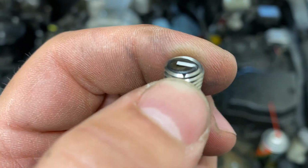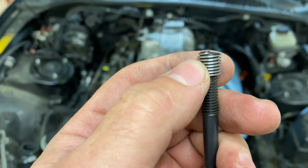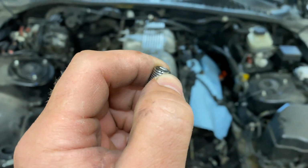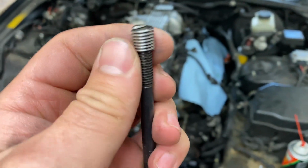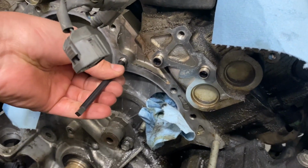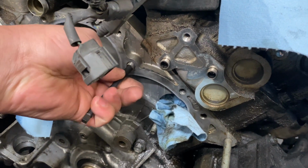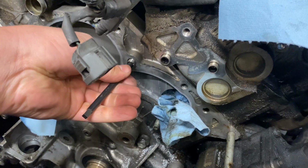Now you also notice there's a little notch there. So what you can do there is once the helicoil's in, you can actually run a punch in and just knock the end of this thread off. And that way your bolt goes through this easily. So this, we just come down, and now we can just get it to catch and thread, hopefully.